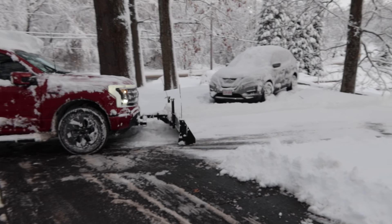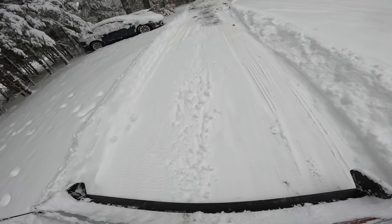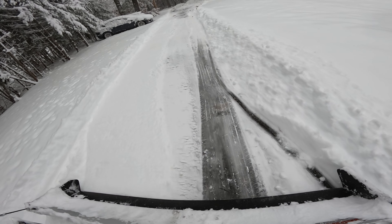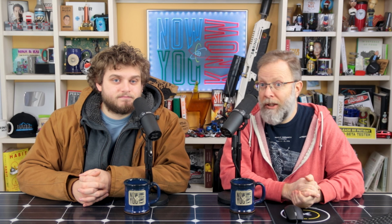As long as you have tire traction, you have all the torque you need to move pretty much any size pile. So we plowed out both houses — both have long, complicated driveways with over a foot of snow. Now, we are using a homeowner's plow, not a commercial plow with up, down, left, right hydraulic controls — that's going to be our next upgrade. That means we can't do what's called pulls, where you lift the blade, drive close to a garage, lower the blade, and pull back all the snow away from the wall. Our plow just tilts and rides along the ground on its two rubber side rails when you go into reverse. Also, even though we can turn our plow left and right, it's manual to do that, so we mainly left the plow in the straight position.